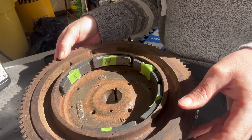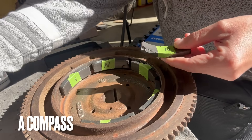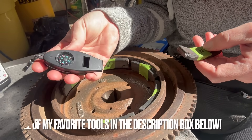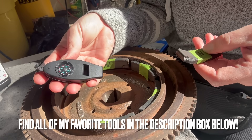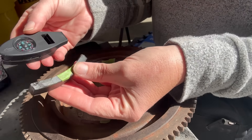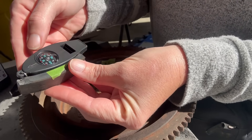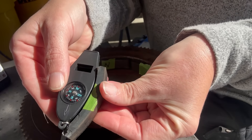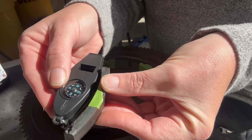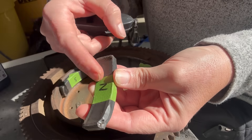When putting it back in, it's going to go north-south, north-south. Each one of these actually has a magnetism to it that's opposite from the next one. To find out how to do it, get yourself one of these compasses - they're like $3.50 from Walmart, I'll put a link below. First we're going to see which each magnet is north or south. Put the compass right in the very center of the magnet - as you can see, this one is pointing towards north right in the center. But if you move it towards the end, it points south on both sides. So we label this as a north magnet.